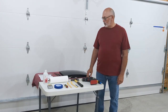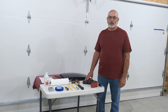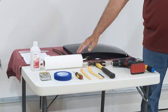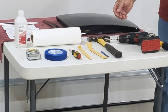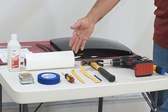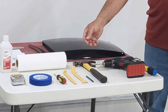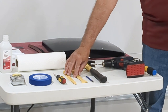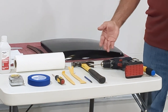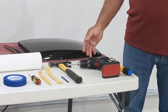Today we're going to install the Speedform unpainted hood scoop from American Muscle. Here are the tools you'll need: isopropyl alcohol and paper towels to clean where the hood scoop is going to go; tape measure and masking tape to help place the hood scoop; a flathead screwdriver and a couple of body tools to help take the push pins out for the liner under the hood — not necessary but we'll use them; a center punch; a hammer; a drill with a 3/16 bit; and finally a Phillips head screwdriver to install the screws.